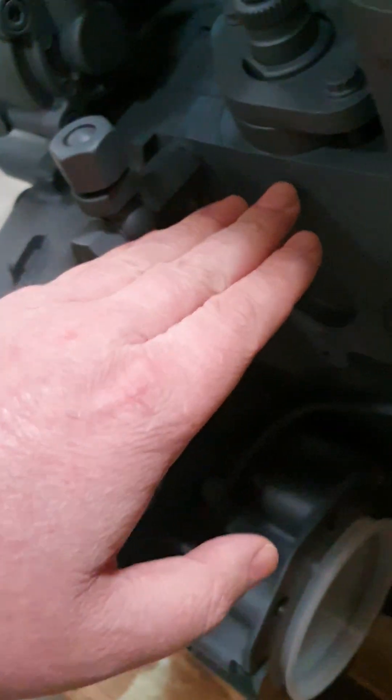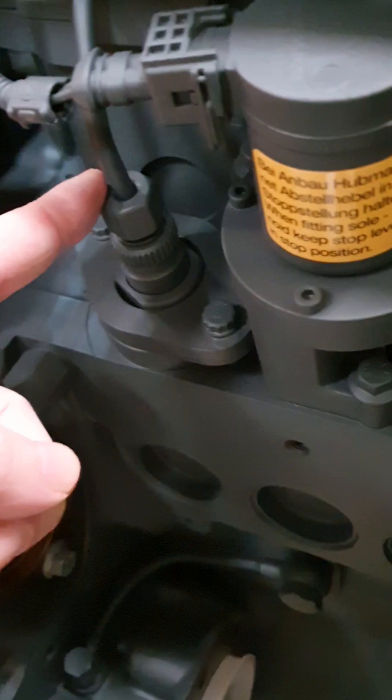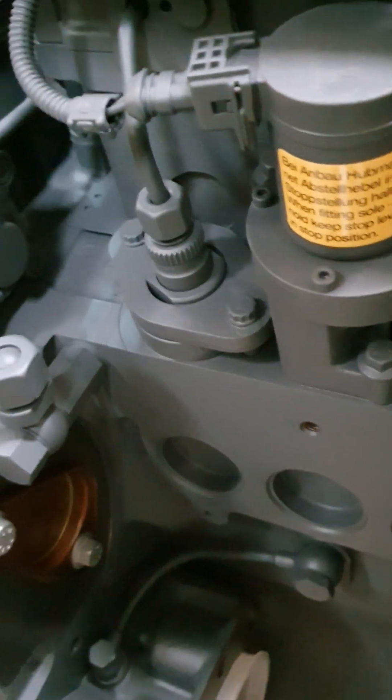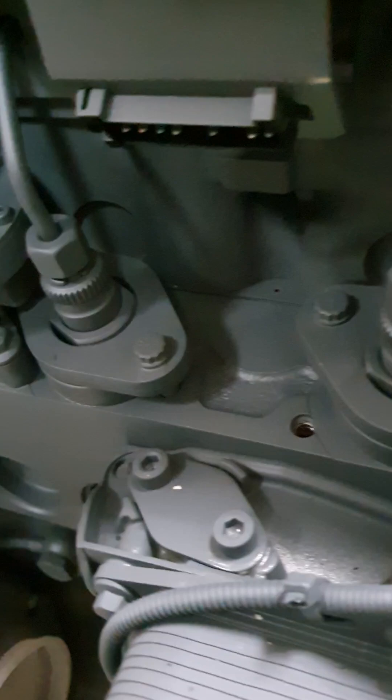In the actual gallery inside the engine there should be about three bar fuel pressure, so you could crack off each injection pump here and see whether you've got fuel actually coming out the injection pumps. It will just pour out — it doesn't inject out — and if you've got that, it means the pumps are getting fed from the gallery.